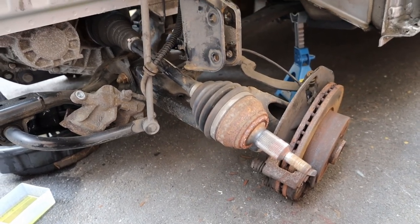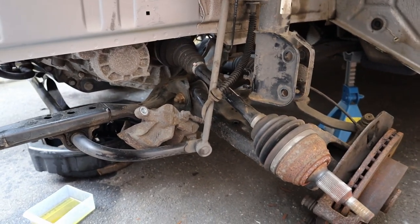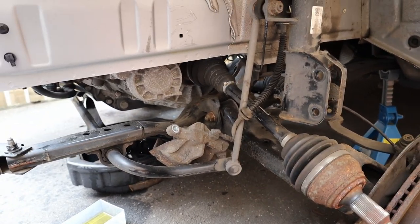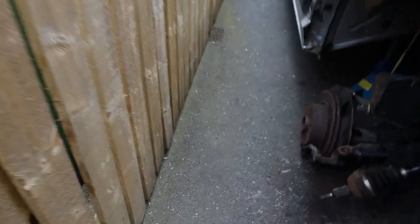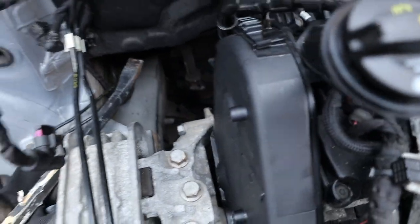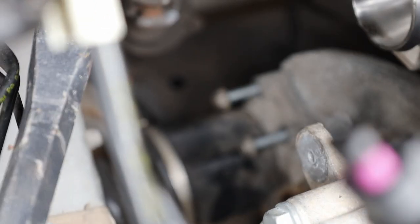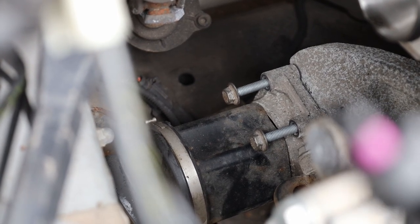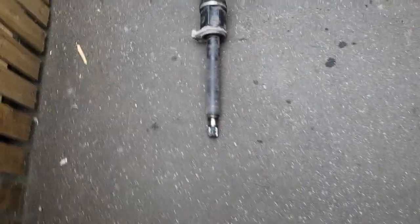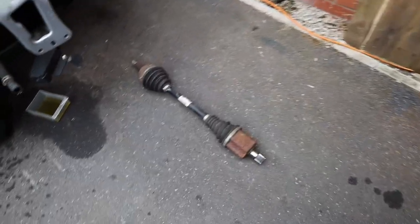That's the drive shafts disconnected from the hub at both sides - it's a pretty sweaty job actually, some of those bolts are well and truly on there. What I need to do now is remove each one of the drive shafts from the actual gearbox. This is the driver's side - same procedure to get everything off except the actual drive shaft has two bolts in it this side. The easiest way to see it is actually down through here. I'm going to reach down through the engine bay and use a pry bar to get that apart where the two bolts are. And two drive shafts removed - obviously this is the one which bolted in, and this is the one that just slides out.